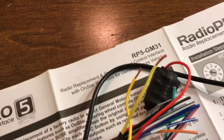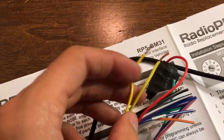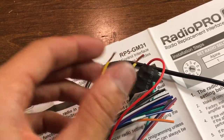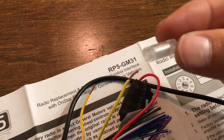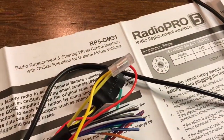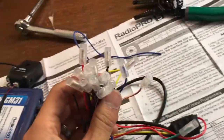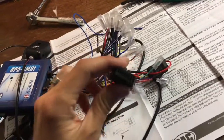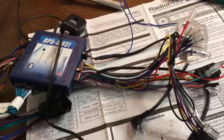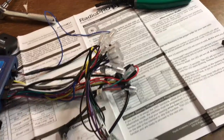This is going to go into this little thing which is the chime. The next thing we need to do might be the most time consuming and you need to be really meticulous about it. There's all these wires and they're not connected, so we're going to take the harness from the stereo — it's going to have wire ends like this — and we're going to match up the colors. That means we have to strip the wires using wire strippers. You strip the one on this side, strip the one on the other harness, and attach them together. So just as an example, we got these two yellow wires here — I stripped both of them. Then I twist them together and put one of these connectors on them. Once you've done all the cables it's going to look something like this, depending on what type of cable connectors you use.